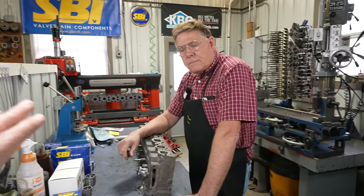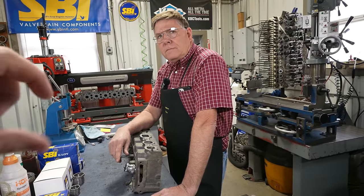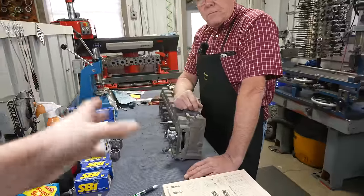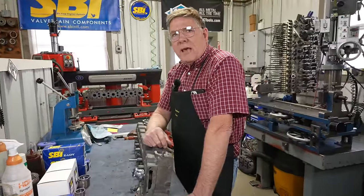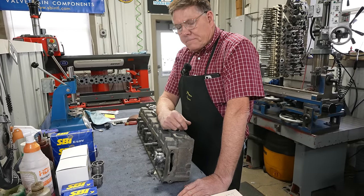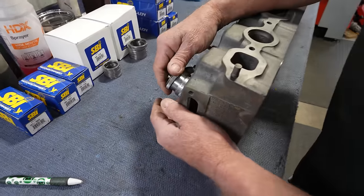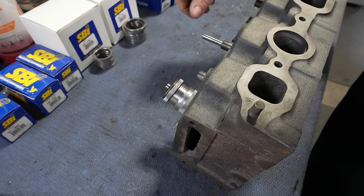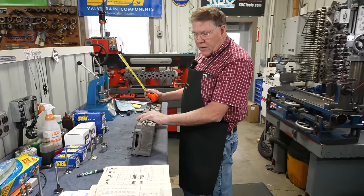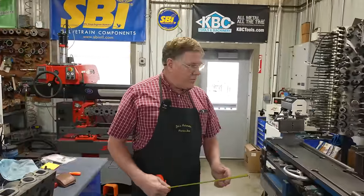That's a personal preference thing, and that's one of the things we like about SBI. If you go in the office, we have SBI seats for every different size, every different depth, different inside, outside dimensions, and different materials depending on the application. They'll recommend a seat that fits well for 90% of the applications, but once in a while you run into something a little off the wall where you want to do it a little differently, so we pick a different seat number and go with it. That exhaust is measuring about the same as the intake — about 30 thousandths slow, 40 thousandths slow by the time we get the valve job done. So we'll mount it up on the TCM-25, get the old guides out, get the new ones in, and cut the pockets to install the new seats.